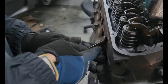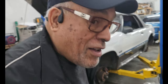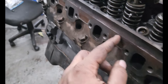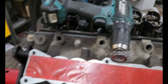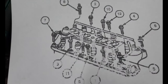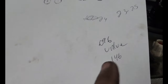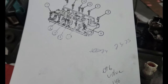Pops, tell us what you're doing right now. We got the heads on already. We're about to torque the heads down. We're about to do the valves. Pops is going to clean up the gasket. So we had to clean up all this stuff — Battle Cat actually helped us too. We're cleaning out the gasket area so we can apply the new headers and everything. Now I'm going to go through the process of torquing all these bolts. There is a way to do everything, so I got the paperwork thanks to AllData — that's the torquing sequence. You can see which bolts to go number one, then two, and so on. The foot-pounds is 23 to 25 pounds. My valve clearance is 0.96. So right now I'm going to work on this part doing the torque. Stay tuned.